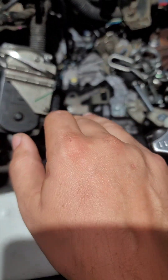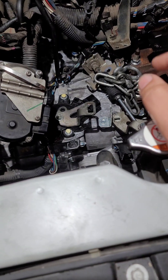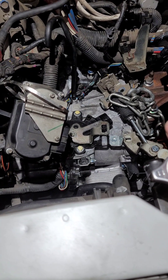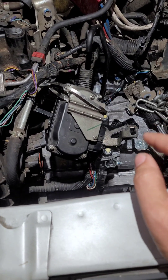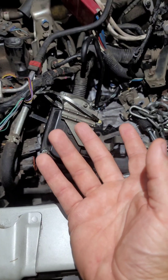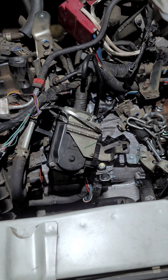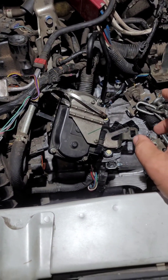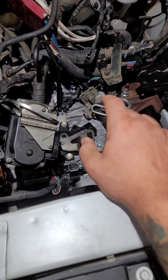I came in from the bottom and got it all bolted together. I think I've got one bolt left to put in on the back side of the bell housing and then it's done. Then I'll start working from the bottom up — all the brackets and aluminum pieces — working my way up to the top, plugging in all the sensors while I'm down there.